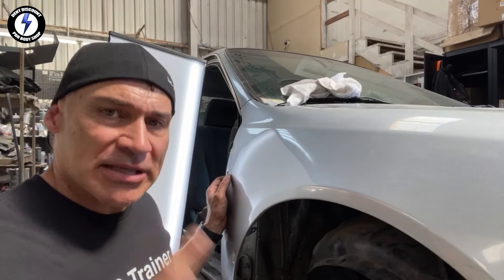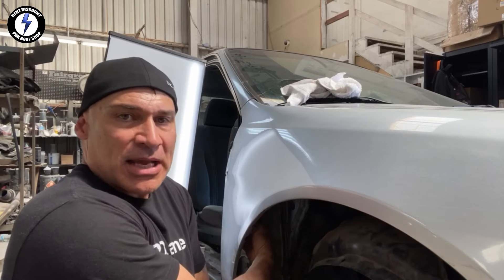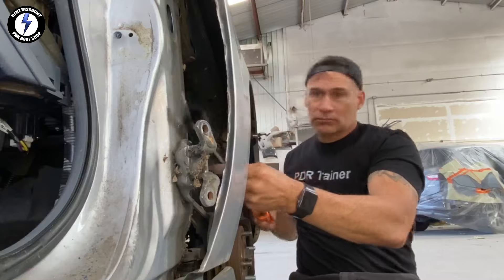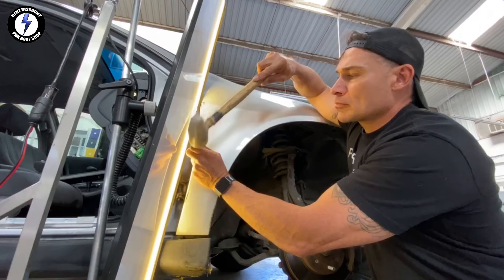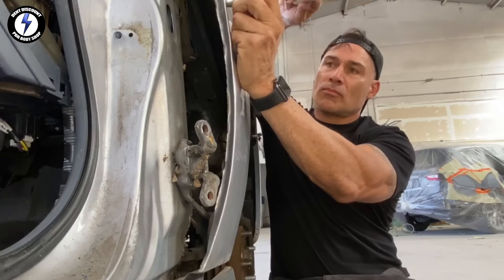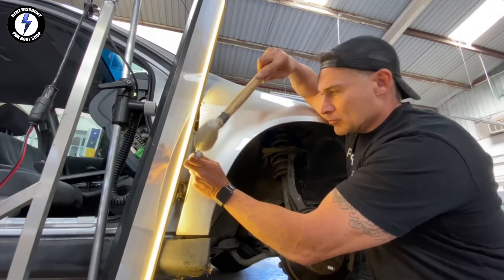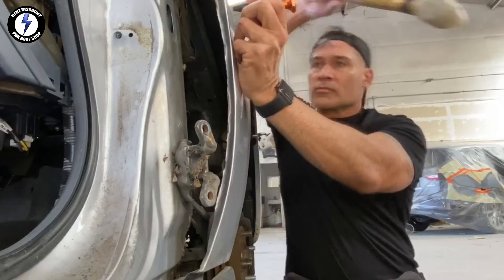The fender jam on the back side is in the way, so I'm having a difficult time getting into the deeper section of the dent. I'm going to grab a really thin tool and run it behind the jam to begin tooling it out. Placing the screwdriver tip in between the open gap and turning the handle, leveraging the tool off the jammed surface. Using my knockdowns to remove the micro highs. The corner tip of the screwdriver is placed on the dent, then I push by continually twisting the handle — the tip is really sharp, so you need to be careful with your pressure. Every push is precise. Being extra patient, not rushing it. I am using this simple screwdriver as a paintless dent repair rod.